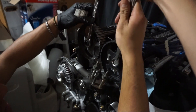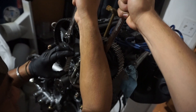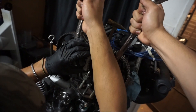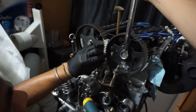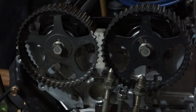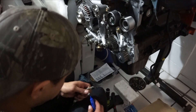I might need an extra set of hands. Which way? Bring yours to the left — a little bit too much. Bring it to the right. Right there. Bring it to the left a little. That keeps the hands in place. Now I will torque these down and put on the timing belt. Torque what down? The hydraulic tensioner bolts. A little dab of Loctite — don't need to overdo it. This is for the tensioner. Just a little dab is okay.